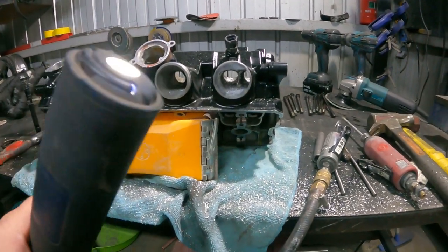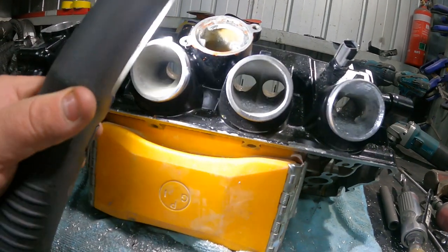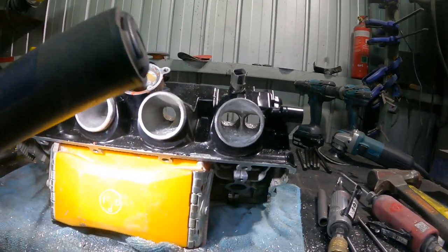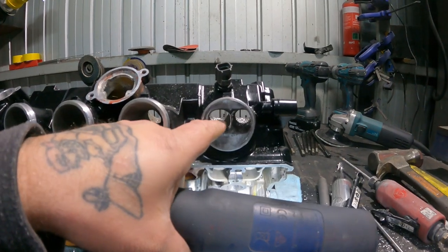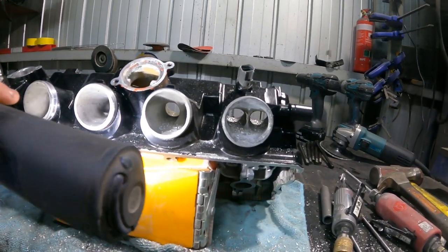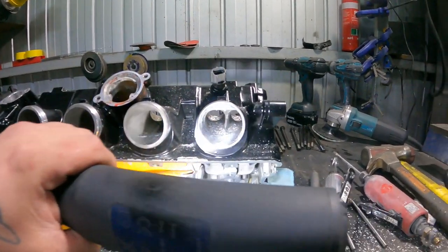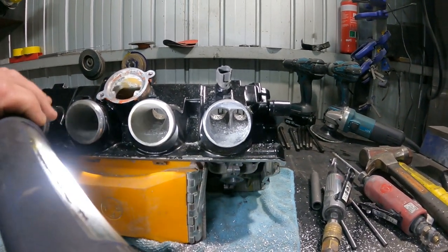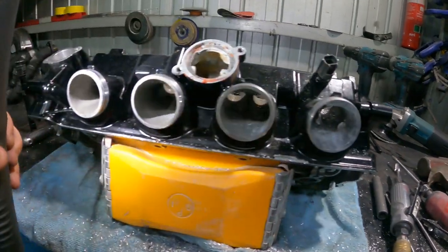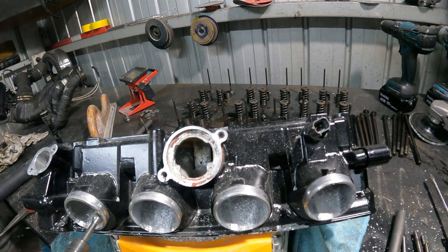Alright peeps, I'll just show you how much of a difference I've taken out so far. As you can see how much bigger it is - opened up the window quite a bit. I've got to get the longer bit down in the actual valve holes and get a little bit more. There's a lot of meat there. So far so good - you can see the difference, it's about another five mil I've taken out. I'll keep going on all of them and we'll clean it up.